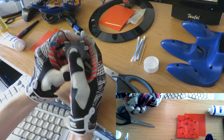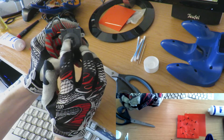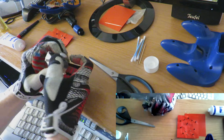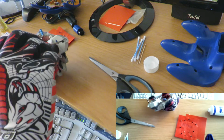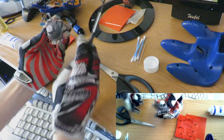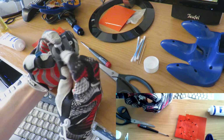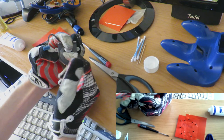Press it together and move the stick a little bit around in every direction, so the silicone grease will spread into every corner. Also test if nothing is stuck and the disc stays flat. Do not use too much strength when assembling everything again. It's plastic. Here the grease can come out again if it's too much. But this is not a big deal, just clean it with a paper.